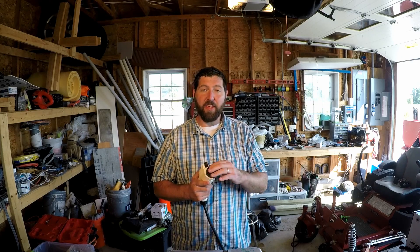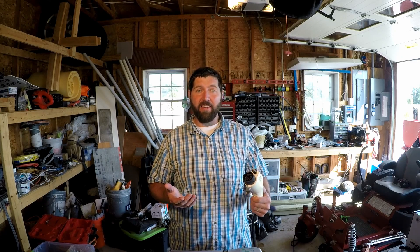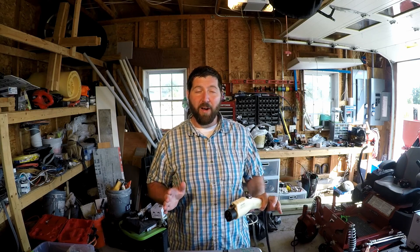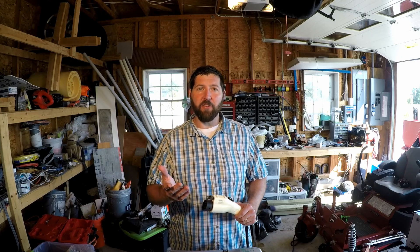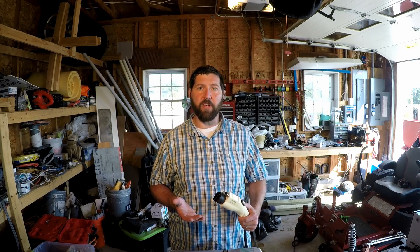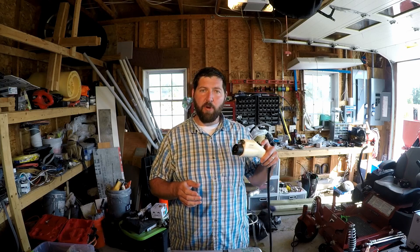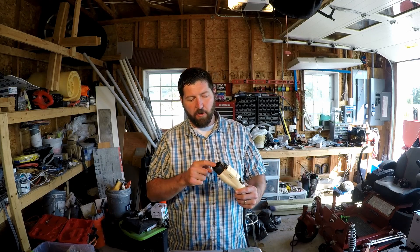Number 11: people are worried about touching the plug. Nothing on here is going to hurt you — you could lick this thing and it's not going to do anything. There is no power at the handle that will ever hurt you. You could plug in while standing in a puddle, be soaking wet, have rain all over your hand or the connector — you're not going to get electrocuted. The EVSE is just a high-tech switch. With this J1772 plug, as soon as you hit the button to disconnect it, it kills all power coming through here within milliseconds. One of these terminals is a pilot wire that communicates with the vehicle — when the button gets pushed, they stop communicating and all power is cut off.